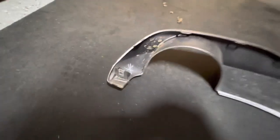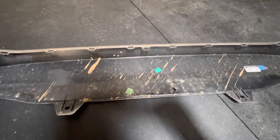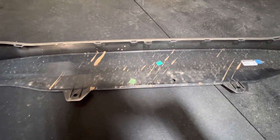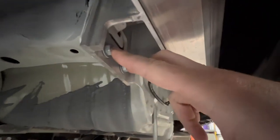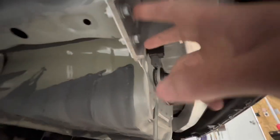I'm going to get up from underneath the car and show you what it looks like. Looking down on it — here are your little screws that we had to take out, and then the little pop rivets: one, two, and three. These little tabs you have to work around; there are quite a few that hold it in. This is the piece we have to cut for the hitch to go on. Back under the vehicle on the driver's side — there are going to be two 12mm bolts here and two on the other side; this is where the hitch is going to mount. You can take these out without worrying about anything falling. Go ahead and take the two out — that's where our new hitch mounts.